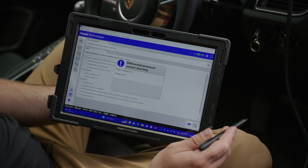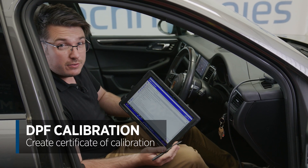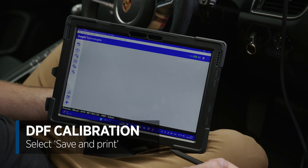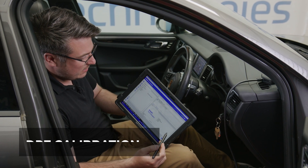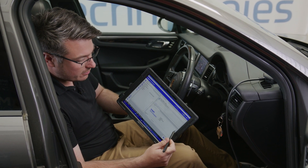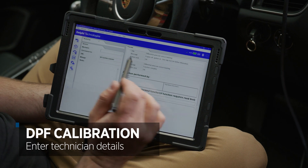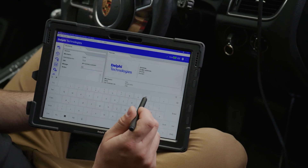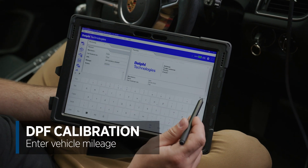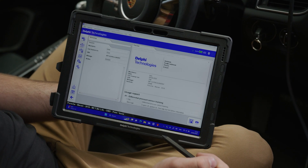So now we can go ahead and actually start the procedure. What we're going to do now is create the certificate to show to our customers and for our records that we have completed the calibration. Click save and print to the bottom right there, and here it's going to preview in the bottom right-hand corner what the certificate is going to look like. We can put in who the technician was that carried out the job. The VIN number is already carried over from where we inputted it earlier, and the current mileage of the vehicle. Any additional notes can be added here and then that's the certificate complete.